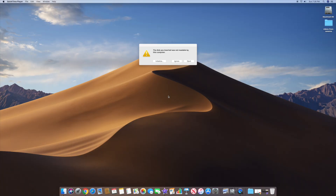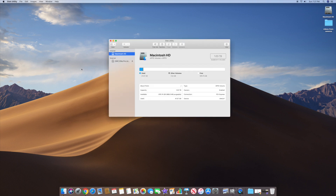After plugging in the drive via the USB-C port, you're going to get a message saying the disk you inserted is not readable by this computer. If you get this, you don't want to click ignore, don't click eject — go ahead and click Initialize. It's actually going to bring up the Disk Utility screen. In here, we basically have to select the new drive and we're going to erase it and repartition it, basically making it into a disk that the Apple computer can actually read.